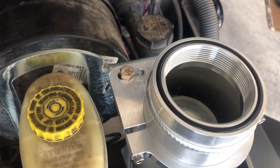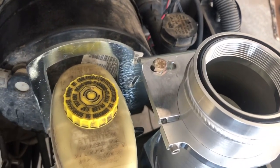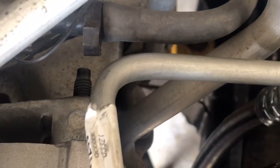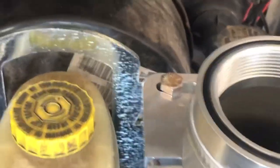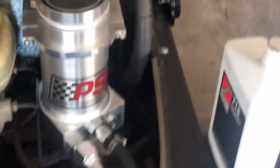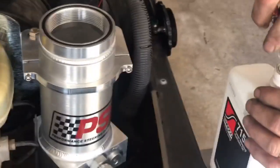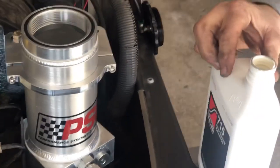That's cycling the impeller and the pump. There's a good look down there at the steering linkage that we shortened — turning really nicely. Your steering wheel, tie rod, drag link, everything turning nicely. The fluid level dropped significantly — nearly empty. PSC sent four quarts, but we're not running the ram, so those ports are blocked off, meaning less fluid is needed since it doesn't have to fill the ram or the hydraulic lines going to it. But one quart she gobbled right up.